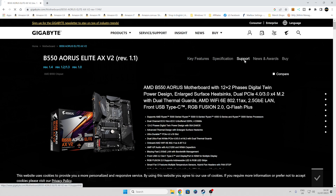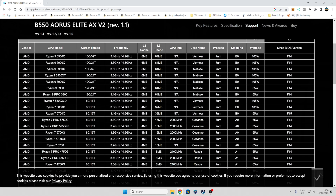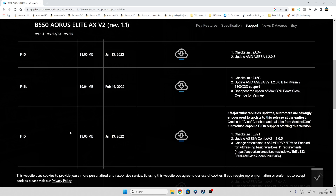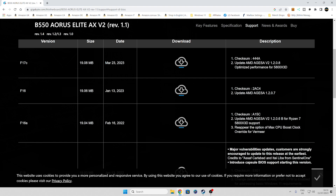Head over to the Support tab and you've got options like CPU support. If you're not sure which BIOS you need, you can look through and find your processor. But realistically the best thing to do is go with the latest one, which will also have security fixes. In the BIOS section you can see various versions available. Beta versions have a letter like A or C on the end rather than F16 or F15 — they don't specifically say beta but that's the tell. The latest one we have is from the 23rd of March 2023. We want support for the 5800X 3D which we're putting on this board, so we're going to download this BIOS.